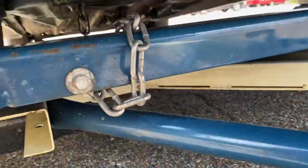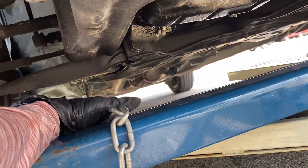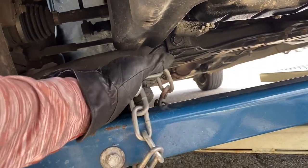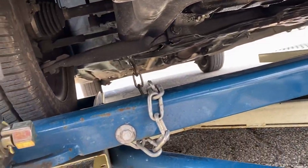Next are the safety chains — super important. One on each side. Most cars have control arms that will have holes you can connect to, as you can see right there. This is in case anything goes bad and your ratchets don't hold — this will be a last-ditch effort to save the car from rolling off. Find yourself a couple of holes, latch them on, and you're good to go.